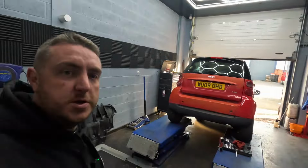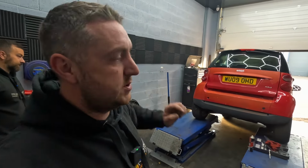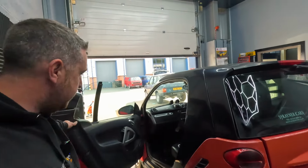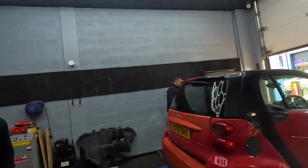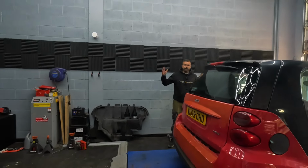Right, so we've got the clutch actuator on there. We're just going to bring it down, chuck the battery on, go forward and backwards, and just make sure it goes into gear. Then once we've done that, we can move on to sorting out whether the engine is actually knocking or it's just got a rattle. Definitely sounds like a tinny rattle, doesn't it? Yeah, 100%. Because when you rev it up, it sort of goes clearer. Yeah, it doesn't get worse and worse like a knock would.